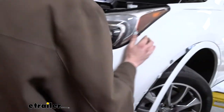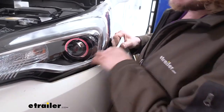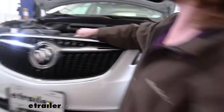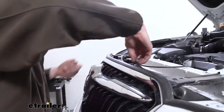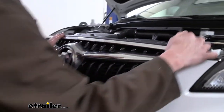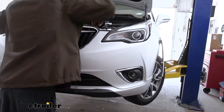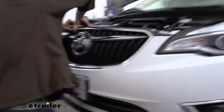We're going to get this side popped out the same way now. Got it popped out the same, so now we can come right back to the middle and pull those two temporary fasteners out — those were just there for a quick temporary minute so this thing couldn't move on us. Now we're going to release these clips on top, just like we did before in the very beginning when we had temporarily sat them back in place to hold our fascia while doing this all by ourselves.